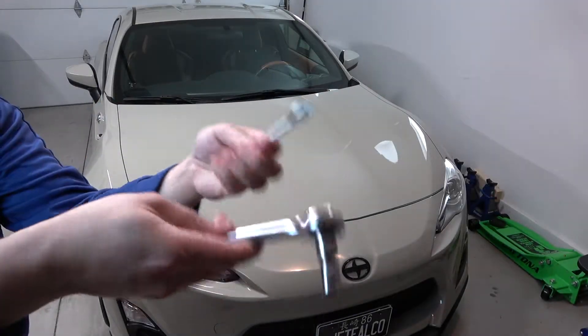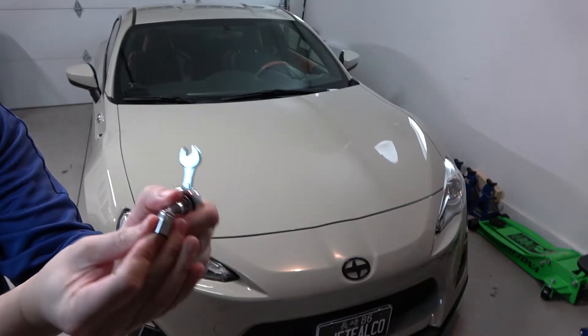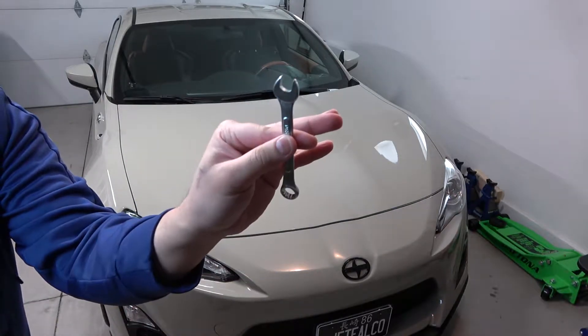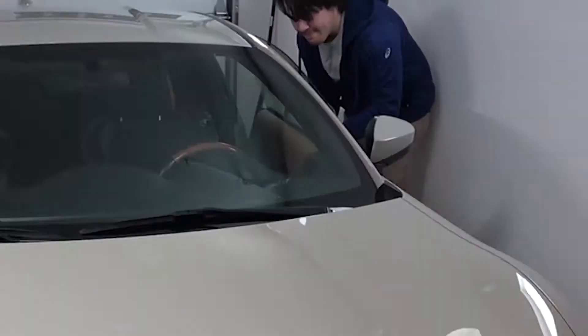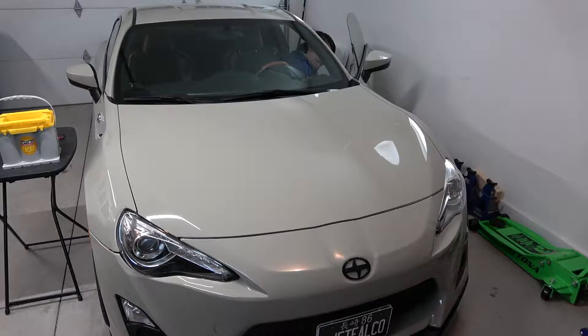Replacing the battery in your car is one of the simplest DIY fixes you can do at home in about 20 minutes, with simple tools like a 10mm socket — a wrench works just fine. If your car is dead and locked, most fobs have a hidden key; if not, refer to your car's manual for the alternate mode of entry. Car batteries have an average life of anywhere from three to five years, so I'm lucky mine lasted as long as it did.